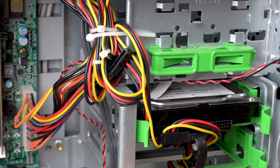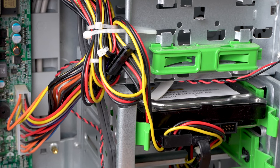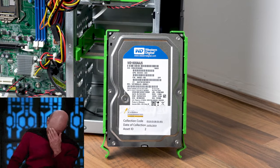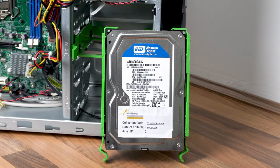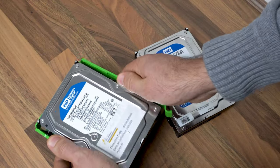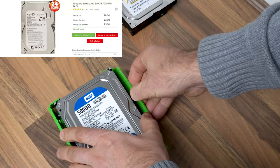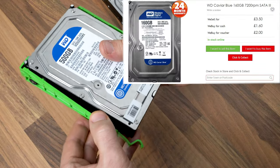This only leaves us with the hard drive, and this is where I made my first mistake. I'd watched a few of these computers on eBay and most tended to be fitted with a 500GB hard drive, so I stupidly assumed this machine would be too — but nope, it's fitted with a 160GB unit instead. Whilst this is enough to run an operating system, it's not enough for a gaming PC when most AAA games are at least 50-60GB nowadays. So I pulled this drive out and swapped it for a 500GB drive — you can pick up 7200rpm 500GB drives at CEX for a tenner. I've added this cost to our final tally, and we can sell the 160GB unit back for a few quid.